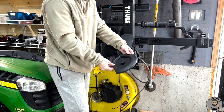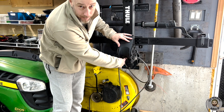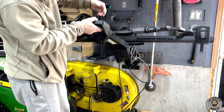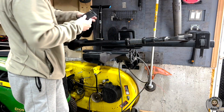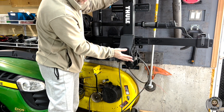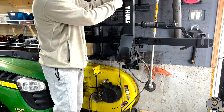With the two plastic side panels now removed, we're going to put our attention onto the center plastic portion cover that will need to be removed as well. There's one single Phillips screw here at the bottom that needs to be removed. With that single Phillips screw removed, we can put the rack in the down position, come to the other side, and remove the front plastic portion. The portion that remains cannot be removed just yet as the locking bar is keeping it in place - we'll get to that later. Now we're going to detail how to remove the handle.